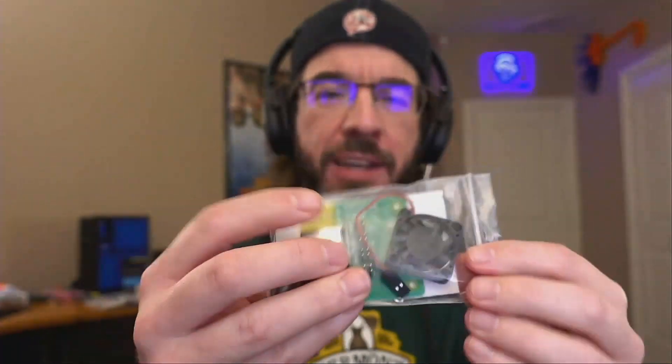This is all the kit, all the hardware. There's a PCB in here for the ATX power controls, which is nifty. You can mount it in the back of your PC — it uses RJ45 in a PCI slot. You mount the PCB in your case, wire the power switch from the case into the PCB, then the PCB into your motherboard, and connect via a regular network cable back to the Raspberry Pi. Now you can actually power the machine on and off if you have to.